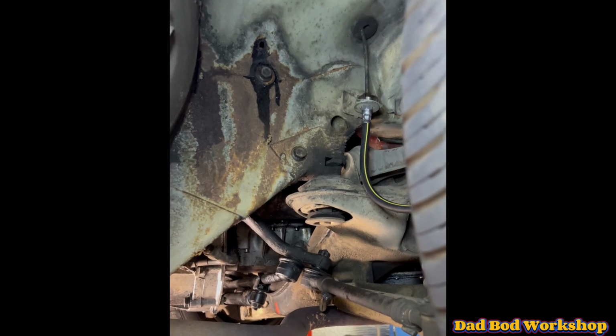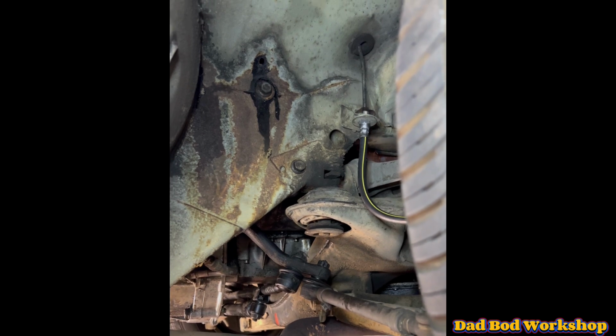Now it's round to the corner around here to do the bolts onto the chassis at 70 to 80. I'm going to do them at 75 Newton meters. And my assistant here, Fraser, is going to get in the car and turn the wheel so I can get to the bolts. Okay, we need to do the 3 bolts to the chassis for the steering box.